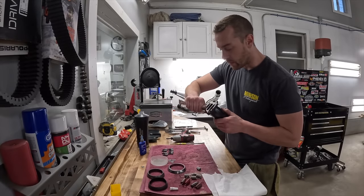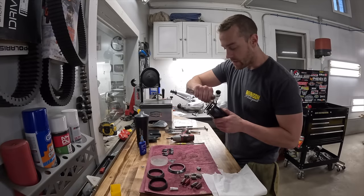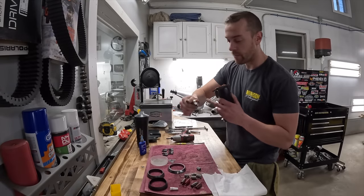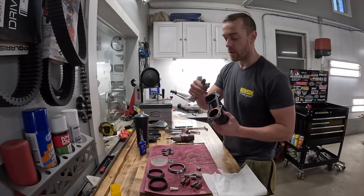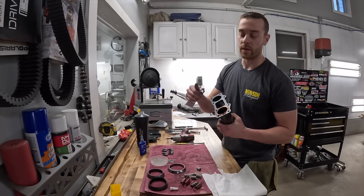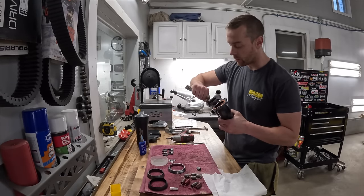If you're using a used tube like this, as you're applying this, sometimes you'll get hardened chunks of the stuff that build up in the cap area. So just watch as you're applying this around here, and you'll feel them after when you go through with your finger. But just watch for those big chunks to come out. You don't want any of those on the surface when you bolt it up. You want this to all be fresh material here, not any of the old dried up stuff.